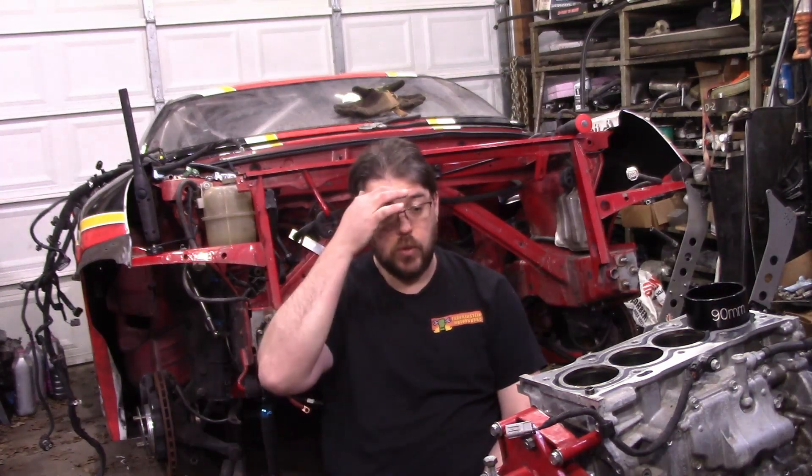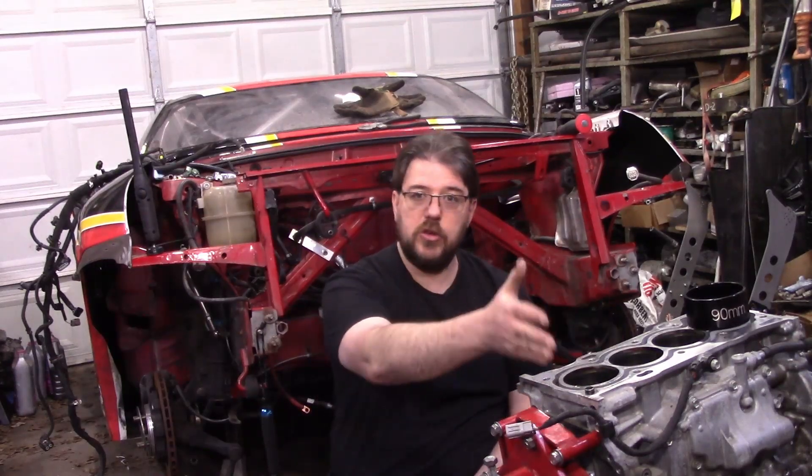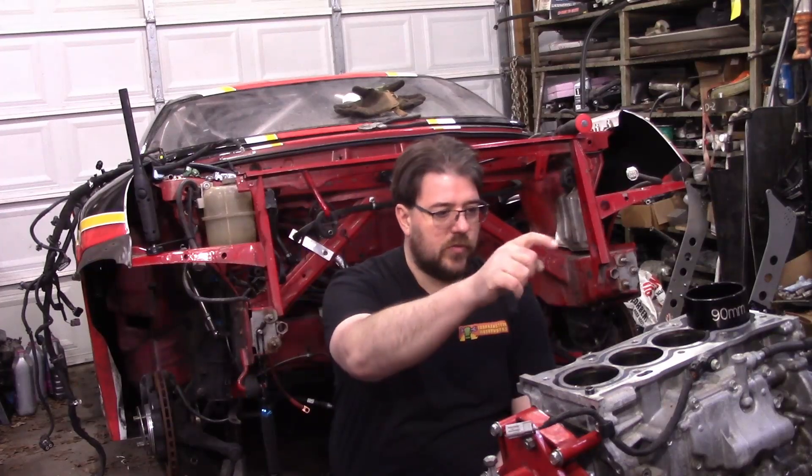I think that explains everything. In fact, if you take the amount of power we're making and assume that was just coming from three cylinders and you add the fourth in, that even gives us a little bit more power than where I would expect to be. I think I just disassembled the whole motor for something that would have taken 10 minutes to swap, and I already have it on the shelf. Frustrating. Though at the end of the day, all that this is going to cost to put back together is a fresh head gasket and some RTV — everything else is just labor. Let me go ahead and put this back together, throw it in the car, and let's see what it does.